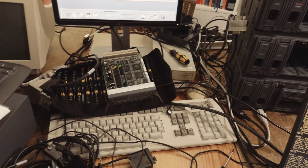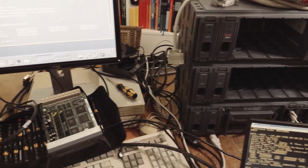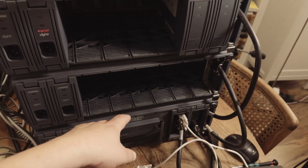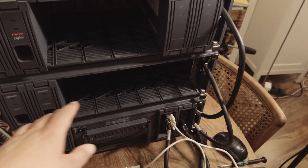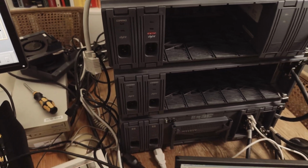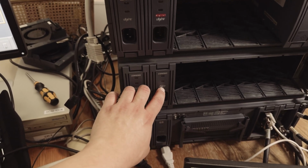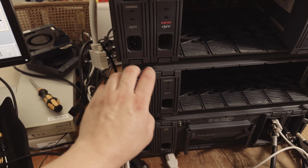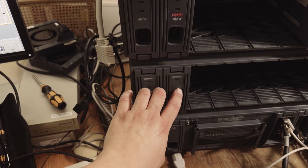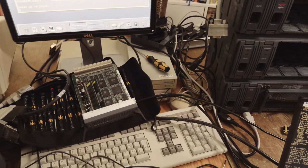There's also a lot of mess on my desk, you can see, because I've tried a lot of things with the HSZ22. I've tried other cables, original DEC cables, and I've tried a terminator at the end, because I thought maybe the auto termination is broken. I've changed the power supplies, I've changed the fans, but nothing happened. I've also learned that some power supplies have this bezel here, because when you want to use it in the bigger enterprise storage array, you have to use a power supply with the bezel under the 180 watt. Otherwise, older power supplies do not work in that modern shelf.